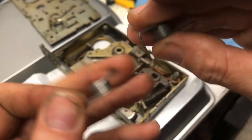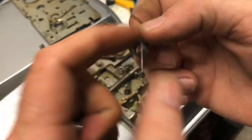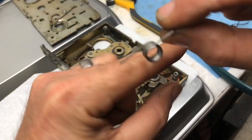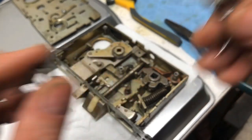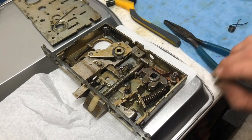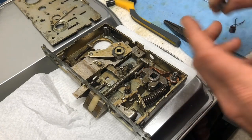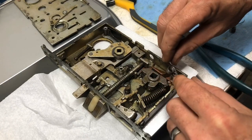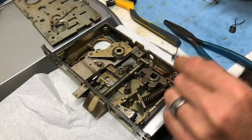We hold these up next to each other. We see this is a left hand. So hold it like that, coils that way. So that is a right hand versus left hand spring. So number one, we need the right hand spring for it to go into there and catch. Number two, none of these that I have really are going to work, because this is a left hand. I don't know, may be able to, no, it's got to be right hand.